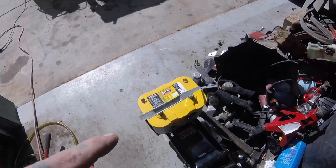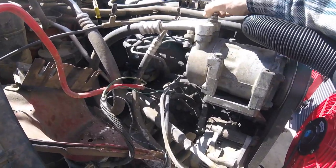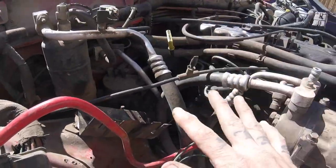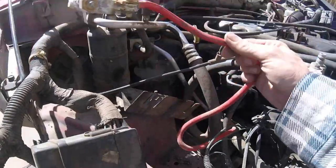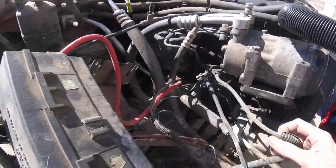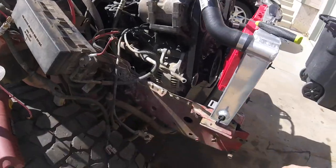I'll still have enough juice to start the vehicle afterwards. I need to cut off these AC lines so that I have an in and an out that I can then tee off of and flare. That'll get all these lines out of the way — the condenser, evap canister can go. We can put the power box back, run our new wire down to where this guy runs and over to here to power the box. The ground I'm just going to cut, put a ring terminal on, and then ground it to the body. That will clean up this entire area.